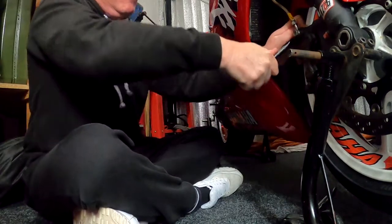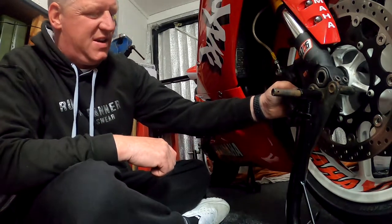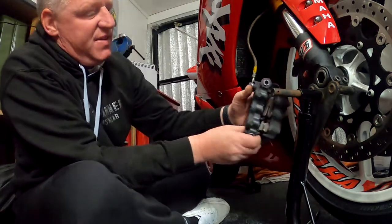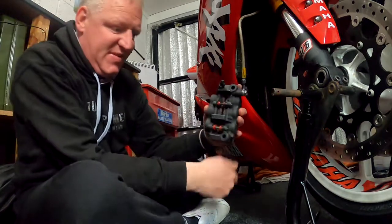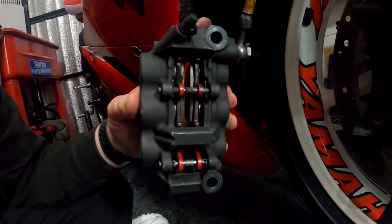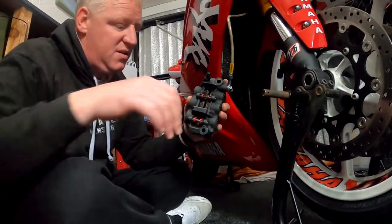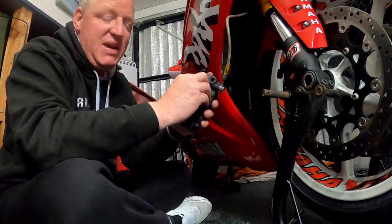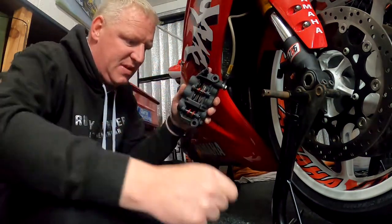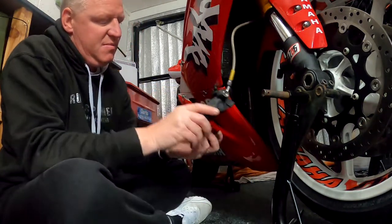Just loosen that off and we'll have a look. What I find just helps sometimes — you've got the calipers nice and loose, just give it a little bit of a twist left to right to free up a bit of space, push the pistons back a bit, and free up space to remove it. As you can see, the backing plates are missing — they weren't there with the bike. I didn't have the problem previously so I doubt that was the issue, but we're going to replace them anyway. Pads are held in simply by these pins and two little R-clips, so we'll just pop out those little R-clips and slide out the pins.